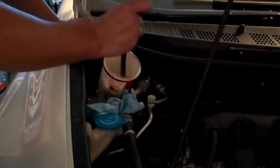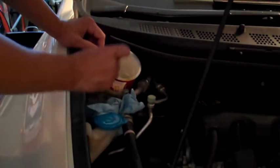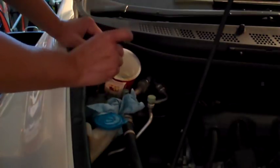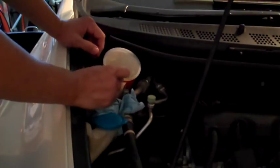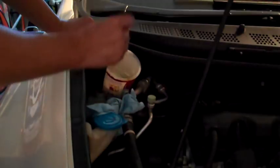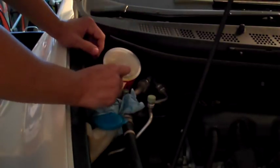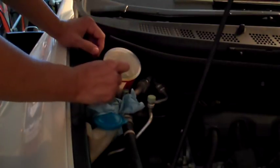I took it to Honda and had them diagnose that whine I was having with the car. They diagnosed it to the power steering pump. Since the car is at 140,000 miles and I'm going to be down in here anyway, I figured I'd go ahead and change the water pump as well. They said I should get all the contaminants out of the system first. My best idea is to get all the old dirty fluid out as much as I can, replace it with clean fluid, and flush through the system. I may do that once or twice depending on how dirty it comes out each time before I start removing the old power steering pump.